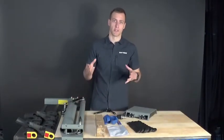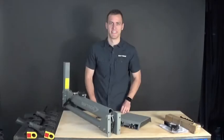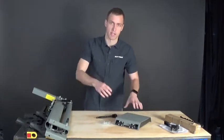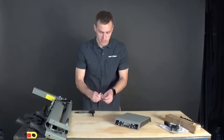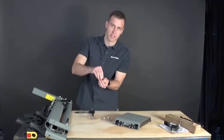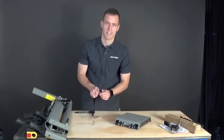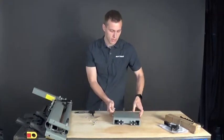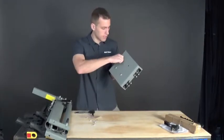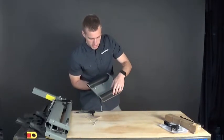One great way to do this is to take the mast of the rack and tip it upside down, setting it down on top of the top plate in the upside-down position. Take out the four carriage bolts and remove the nuts, setting them aside. Then take all four bolts and drop them down into each of the square holes in the top of the top plate. Then take the top plate, holding all four bolts in place, flip it upside down, and now you've got all four bolts lined up through the top plate.